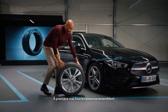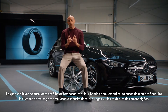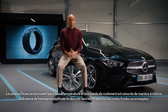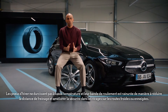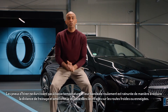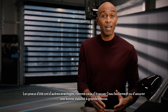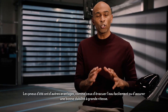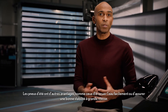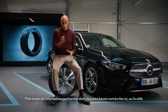Now, at first glance, tires look the same. But there are differences. Winter tires do not harden at low temperatures, and their tread grooves are formed in a way that helps shorten the brake distance and also increase safe cornering on cold or snow-covered roads. Summer tires, on the other hand, have other strengths — good water displacement and stability during high speeds.